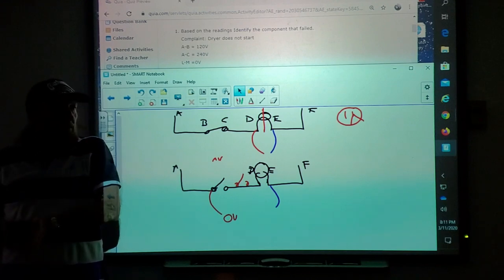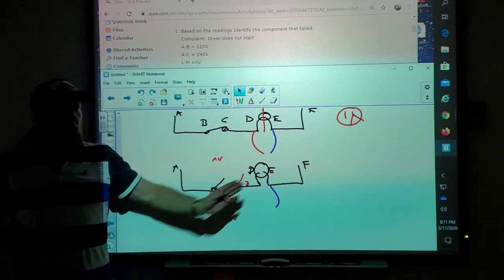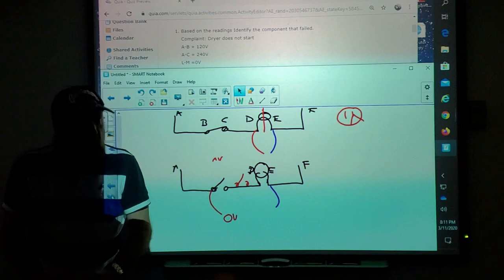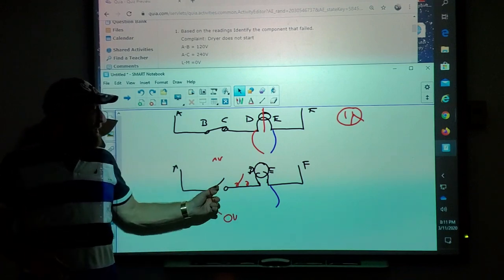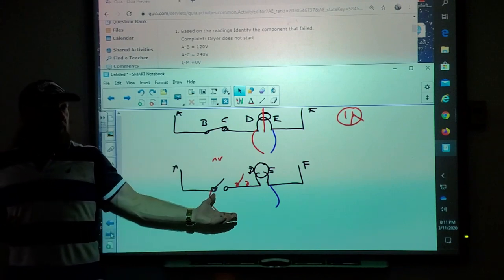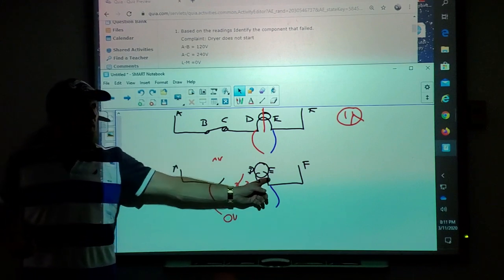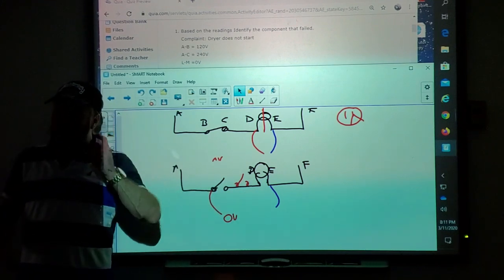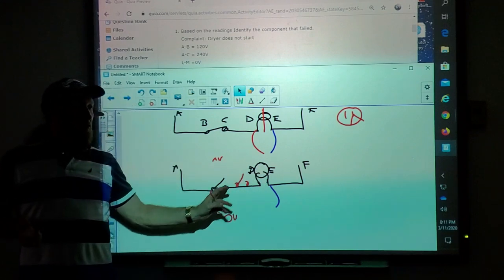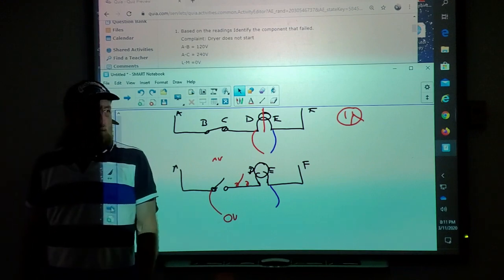It doesn't happen often, but sometimes a part like a motor may go. The motor had an internal short, and what could happen to the switch if you had a short circuit? You could blow out the switch too, right? One thing you could do is try to bypass the switch and see if that motor works after that to confirm that's the only thing wrong. But if the motor shorted out the switch, what'll happen if you bypass it? You blow out that part too.